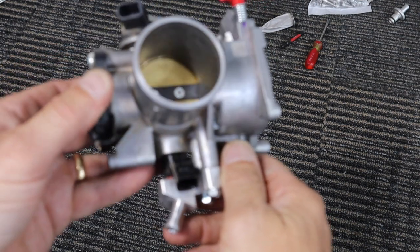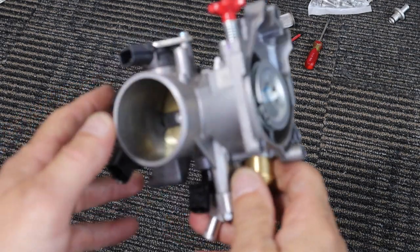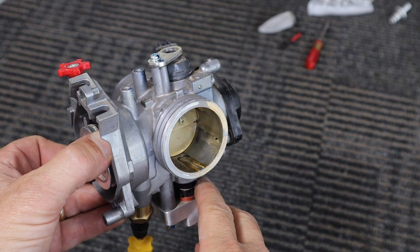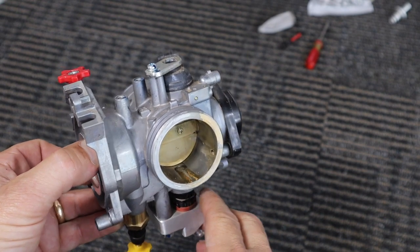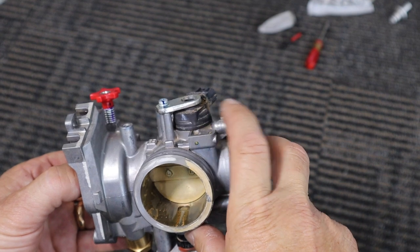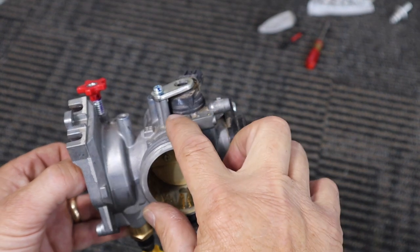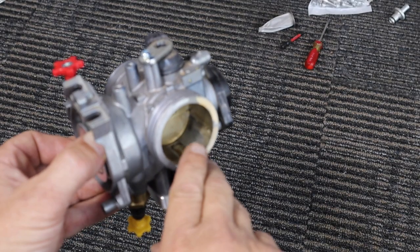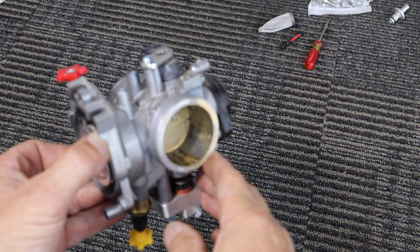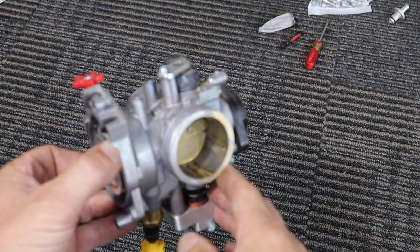How perfectly clean that is — so it's all crap from the fuel. Anyhow, the purpose of this is cleaning the MAP sensor, which is right here. MAP stands for Manifold Air Pressure sensor. It runs down through these orifices in here and comes out on this small little hole you see right here. This is the one that picks up your elevation changes or barometric pressure changes.